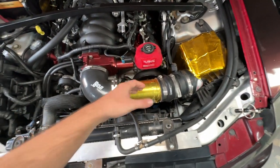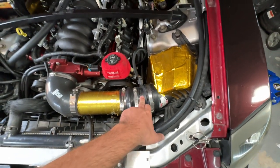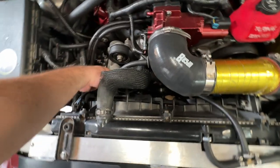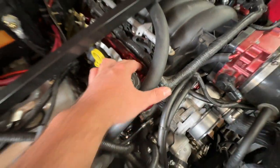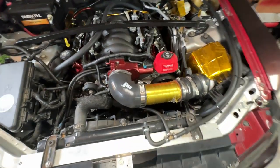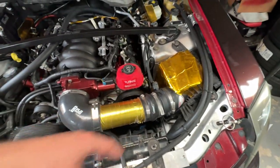First order of business before I take the black V out of the garage - I need to steal the intake back off of this car. The intake on this car is the one from the black car. The air box and MAF sensor belong to this car, but the coupler tube, coupler, and the hose that's zip tied to my fan goes to the valve cover on the LS2. On the LS6 that hose goes to the throttle body, so slightly different hose routing on the cars.